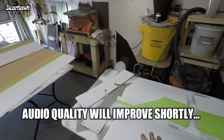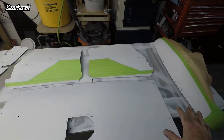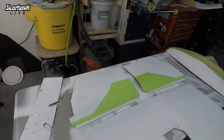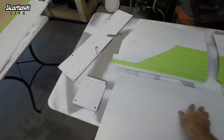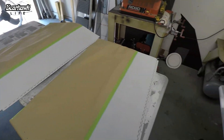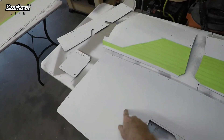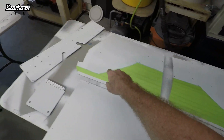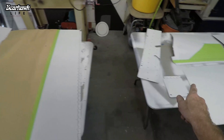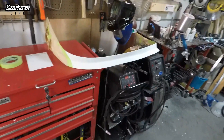Right now I did the priming outside - one of my lessons learned from the fuselage was that priming inside the garage is a mess. Primer is so dusty and it sticks to everything, and you have to lightly sand it anyway. I just took everything outside last night and primed it, brought it back in, and just took some 320-grit open-faced sandpaper and lightly sanded everything. I'll blow this all off before I put the top coat on. Everything is masked - this is the top of the engine cowl, oil door, boot cowl, front of the boot cowl, oil door, nose bowl, cowl doors - all going to be flat black.